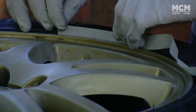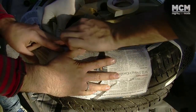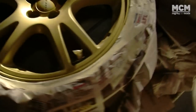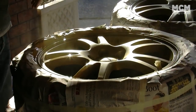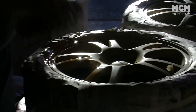Next up, mask up the rims so you don't get any paint on the tyres. If it's a particularly cold day, a good tip is to heat up your rattle cans to make them spray much more evenly. Filler primer is like bog in a can and helps fill in any tiny scratches. Once it's dry it can be sanded off for a clean, uniform surface ready for the base coat. Sand that back, throw some primer on, then the base coat, then the clear coat — and it's done. You can be pretty heavy with the primer as it's going to be sanded anyway.